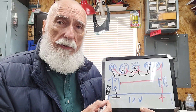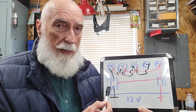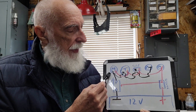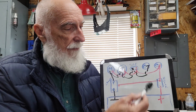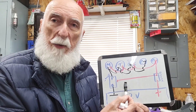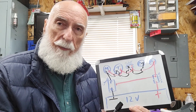The shunt helps do some magic that makes the meter work. It has two distinct sides — a battery side and a power-out side. You want to make sure you put it in correctly. From your negative it goes to the battery side of your shunt, then straight across to the power side. Just like the red side, your negative sides are going to be connected together. From here it goes to the meter, to the trolling motor, to the SAE, and stops at the negative. Anytime you plug anything in, it's going to be a complete circuit. There's also one light wire — 18 or 16 gauge — pulling off the positive running over to the shunt to supply power to the meter display.